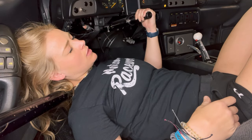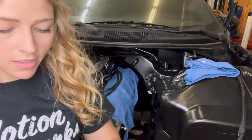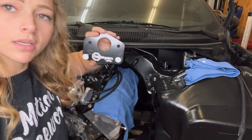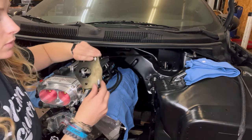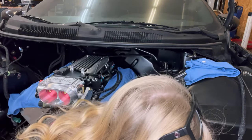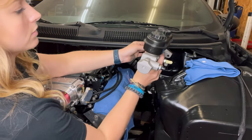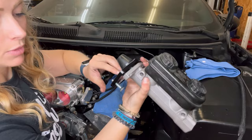I need a chiropractor visit after this. Okay, so now we have our push rod poking out through the firewall right there as you can see. Next step is this plate — this plate is going to go onto the firewall and it will have bolts that go on the other side. After that gets put in, the master cylinder will go through this hole and then you have two more bolts to put in.